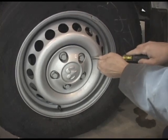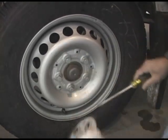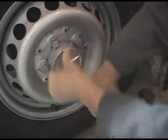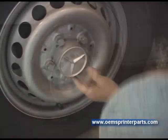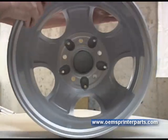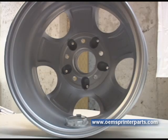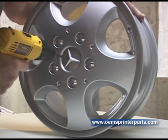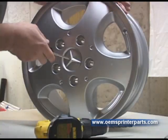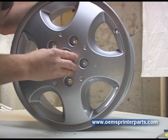The hubcaps on the factory steel wheels are held in place with tabs that grip the lug bolts. Using a large screwdriver, pry loose and remove the factory hubcaps. Align the tabs on the Mercedes hubcap with the lug bolts and push into place. Be sure each tab is firmly locked below the flange on the head of each lug bolt. To remove the center caps from the factory alloy wheels, remove the wheels and push the center cap out from the back side. You can also remove the center cap without removing the wheels by drilling a small hole in the factory center cap and prying the caps free using a hook tool or screwdriver. Align the new Mercedes wheel center and push into place.